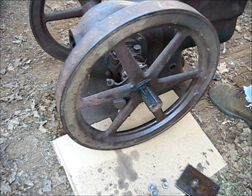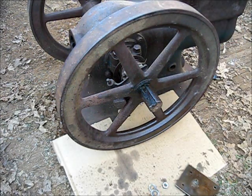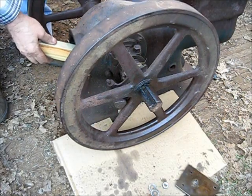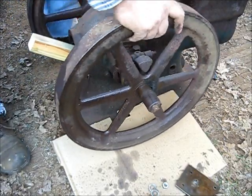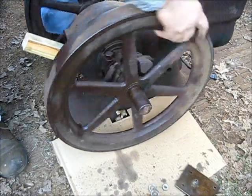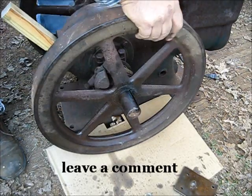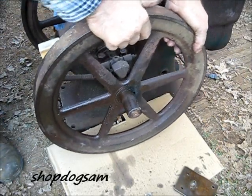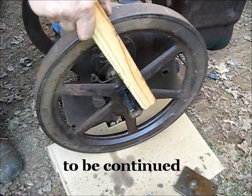There is a kind of — it's not easy — but you can use a jarring motion to help break that flywheel loose. You can insert a piece of wood in the back right there, and when that crankshaft comes around you'll have a jarring motion. With just that amount of movement I don't see much — we'll have to put the wheel puller on this one right here and pull that off, but we'll have to clean up that shaft first.